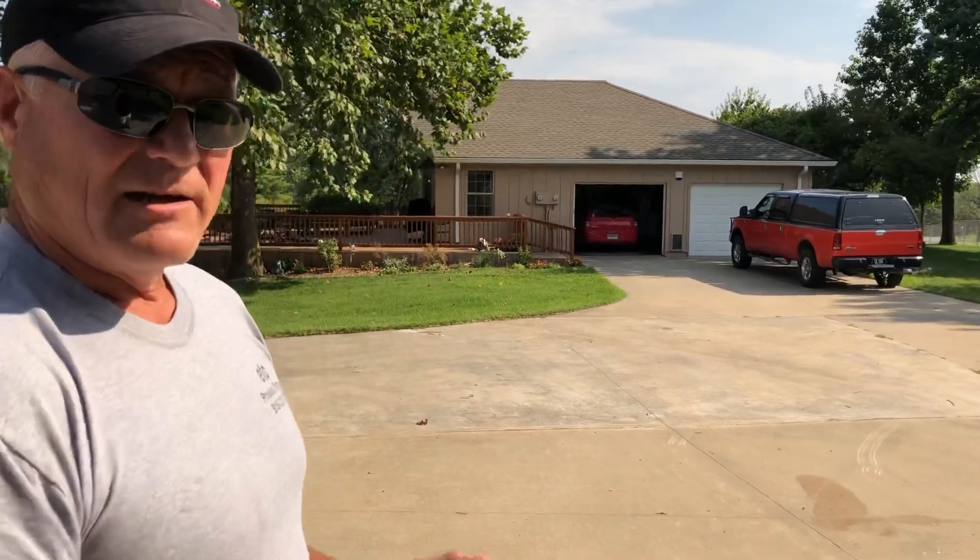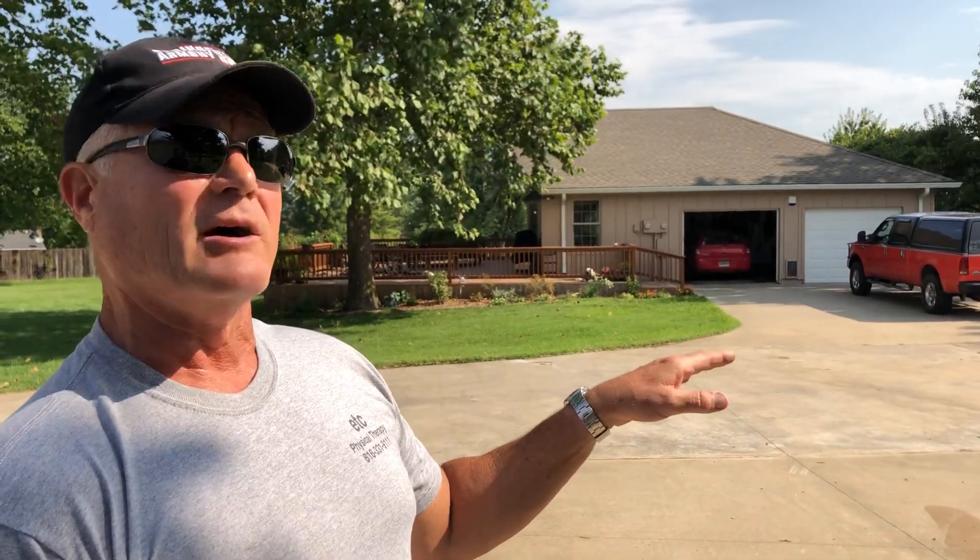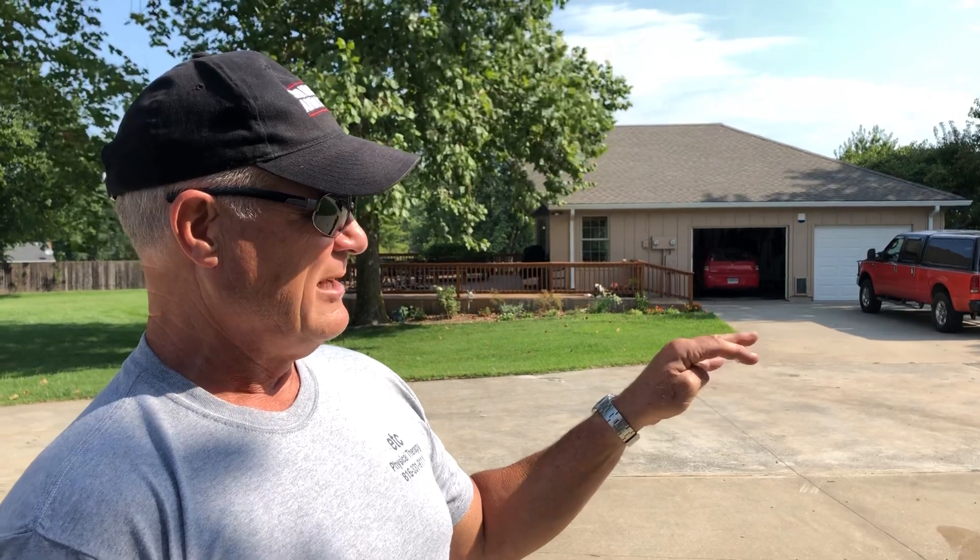The car made its maiden voyage down the road. It went to a neighbor's barbecue party a couple of weeks ago for Memorial Day and didn't drop any parts all the way there and all the way back. We don't have the secondary transmission — the Gear Vendors — hooked up right now, so we're running on the primary transmission only, and we ran about 75 miles an hour at about 1,100 RPM. Once we put the Gear Vendors in, we ought to drop another 200–300 RPM at that same speed.